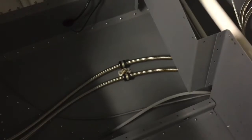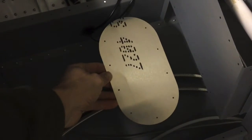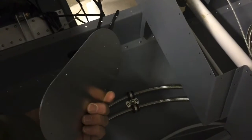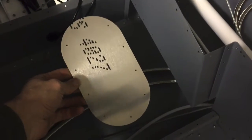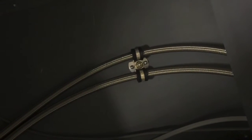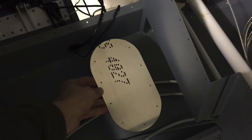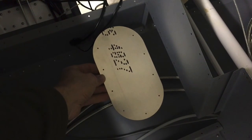One final thing: obviously there's a baggage floor that goes here, and I did decide to put an opening or access area right here. I'm going to order two more access panels from Zenith — one here and one on the other side. That'll always give me access in the future if I need to change a fuel line or a brake line. So I decided I'm going to have one access plate on each side of the fuselage baggage bottom.